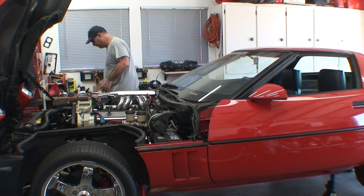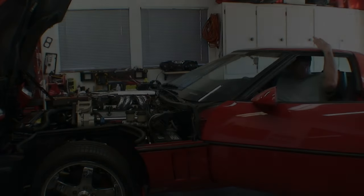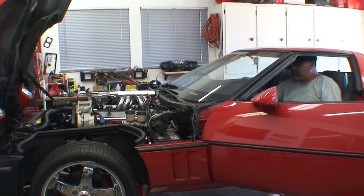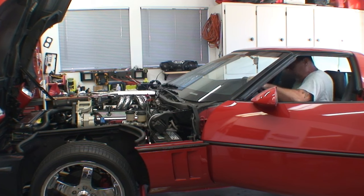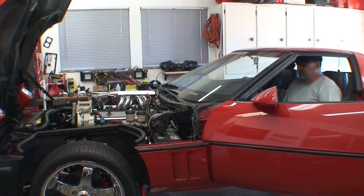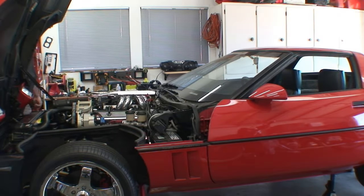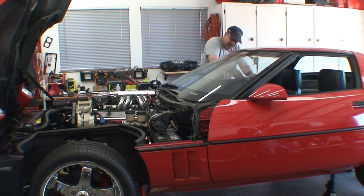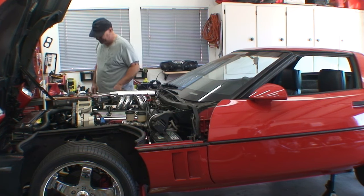Round two. At this point I'm realizing we've got something else going on. I did the best I could to readjust the fuel pressure regulator, but without a fuel pressure gauge it's an art to try to get it right. I knew I was close, but I kept trying and trying. At one point I lost fuel altogether, so I knew definitely something was not right. Now I've got two issues to deal with, so I had to go off camera and go through the process of elimination. It only took me about 30 minutes.